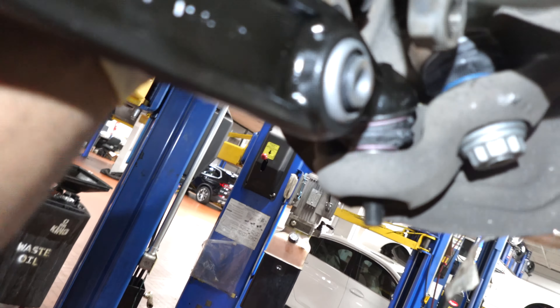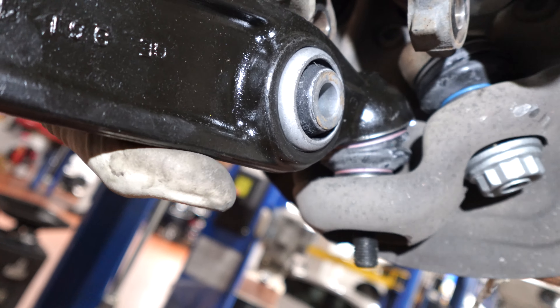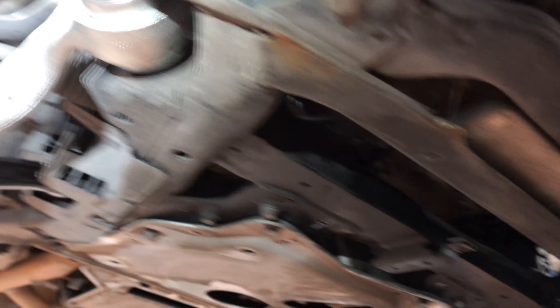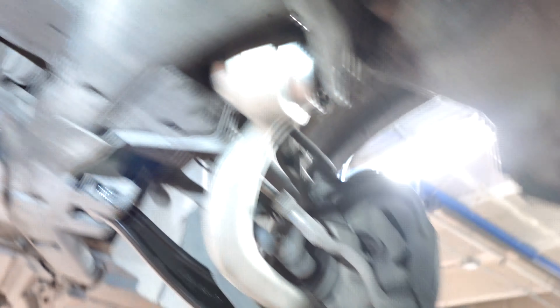What I found — same as the other side — is you just force the fork over a little bit and this arm slides right down into place. On the driver's side I've got everything back together. I'm going to put the trim panels and wheel arch panel back on and put the wheels on. I've got all four control arms installed on both driver and passenger side. I'll take it down the road to see how it drives. I may need to do an alignment tomorrow, but the steering and braking feel should be a lot firmer and it should handle a lot better. Thanks for checking out Cool Fred's Beamer Tech — have a good one!